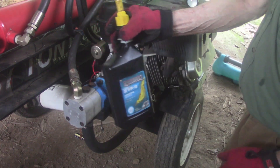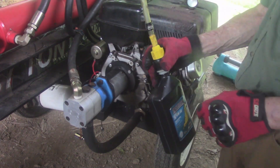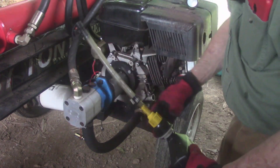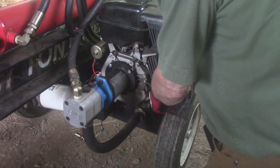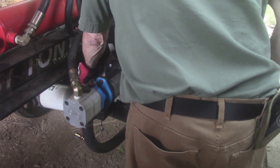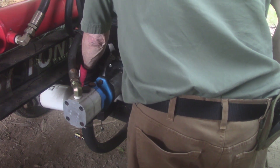Got my can of oil — I don't remember how much it takes, I don't think it takes a full quart. I got my little finger screws on here so I can get in there. I took the drain plug back out because I forgot — you got to fill it up to the threads in the drain plug.